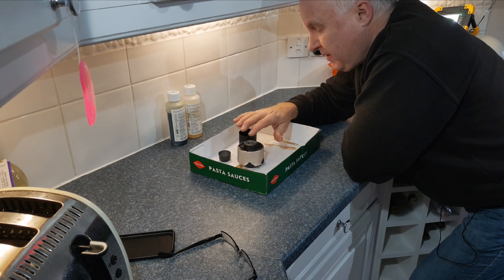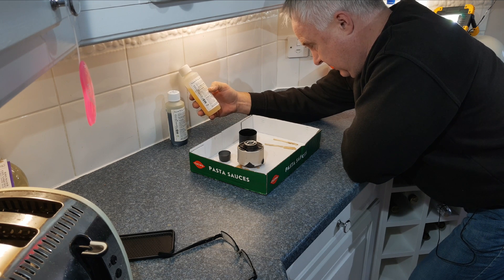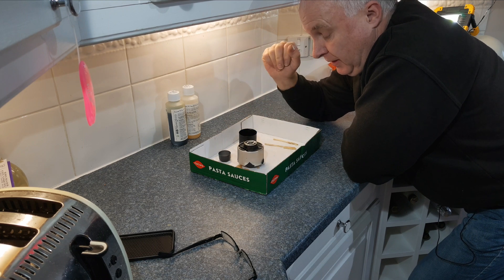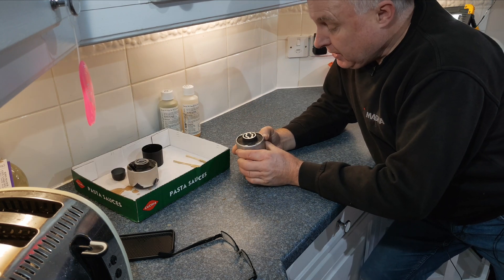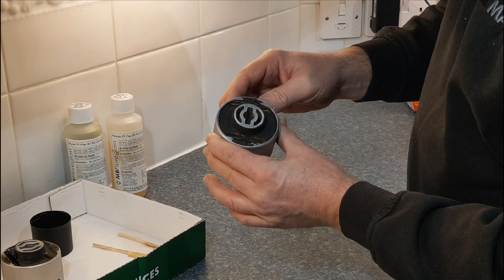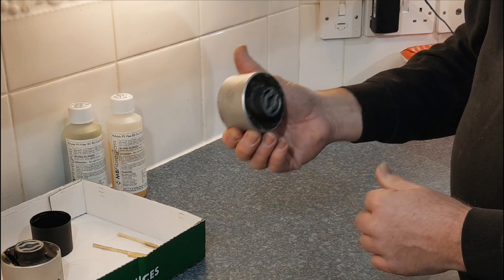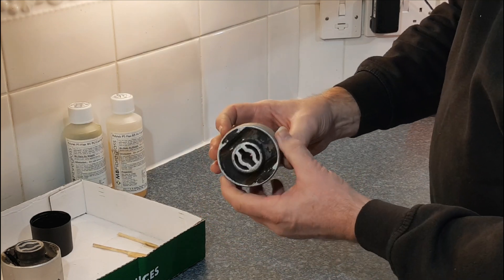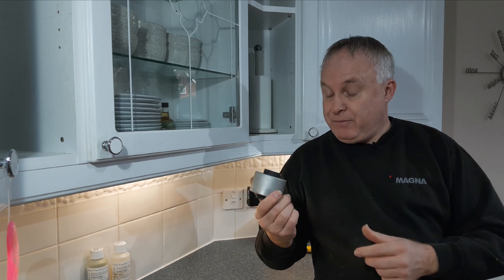The initial cure time of this particular PU rubber is about two hours, as specified on the bottle at 20 degrees C. Leave your article alone and allow the rubber to take its initial cure for those two hours. And in true Blue Peter fashion, here's one I prepared earlier for the other side of the car. Once the rubber has had its two hours for the initial set, remove your tape but leave it at the same stable temperature for 24 hours or so to take a full set. There you go — a pair of Saab 9-3 trailing arm bushes made into heavier duty bushes, now ready to be fitted to the car.